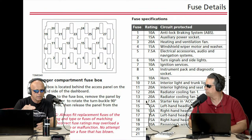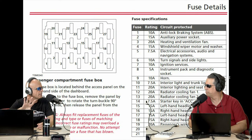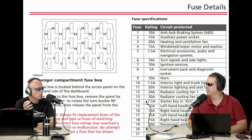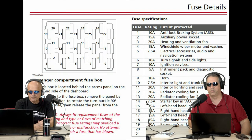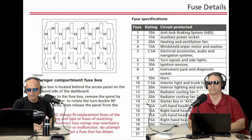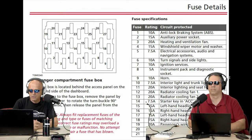The fuse block is on the passenger side underneath the rounded airbag cover, slightly lower above the waterfall — the part that goes down to your running board. You rotate the turnbuckle 90 degrees counterclockwise and it releases the panel from the dashboard, exposing the fuse block. You can see descriptions of the circuit breakers for various functions in the car.